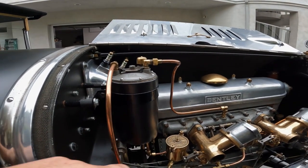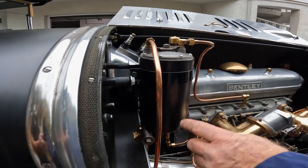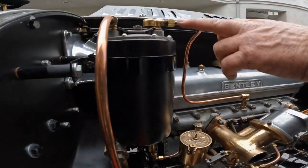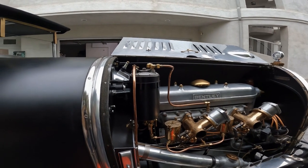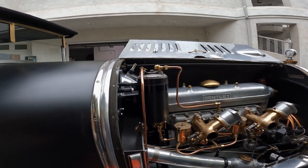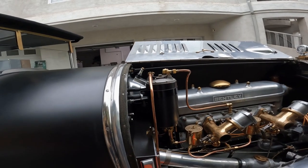Auto-vac — is this our fuel pump? Yeah, that's a vacuum tank. It would suck the fuel into the canister and then gravity feed the carburetor, and it pulls the vacuum from the intake manifold. There's the vacuum right here — it's just got a plunger in there. Oh, that's neat — it's like a needle valve and a float. It works on vacuum drawn from the intake. And the spare plugs are just stored right where you put them.